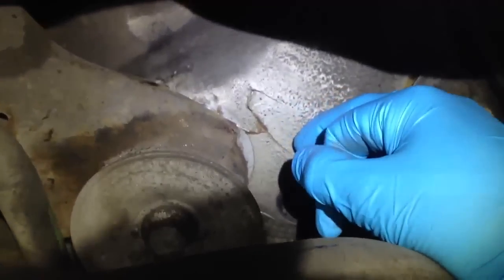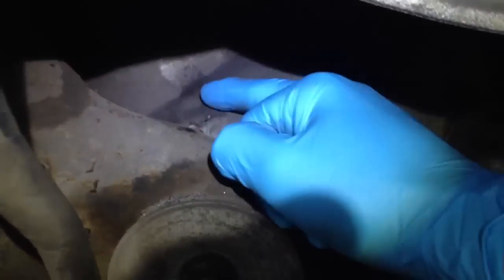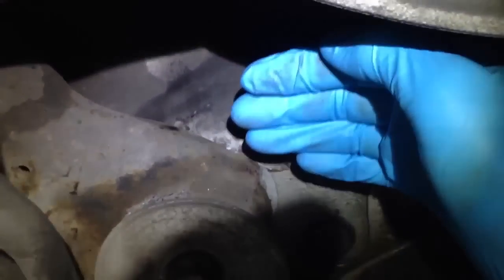Post-February 2000 cars, like all M3s, don't get this type of problem on this side because the mount is held additionally with spot welds here, here, there, and there. That stops the mount going so violently, so it doesn't crack this side. You always just get that crack around the left rear, next to the left rear subframe mount.